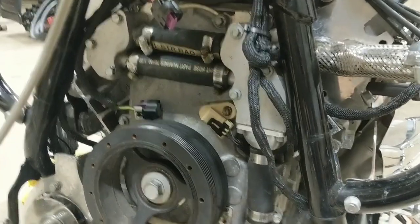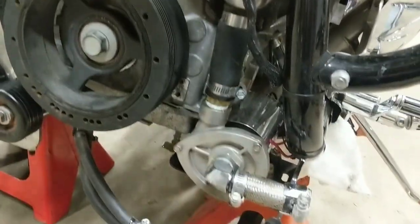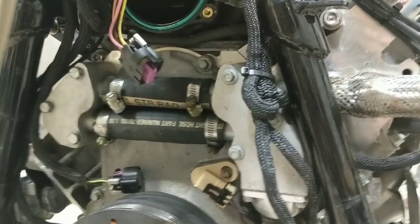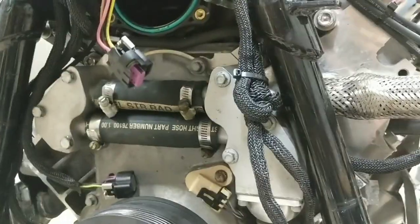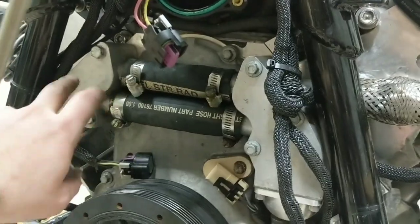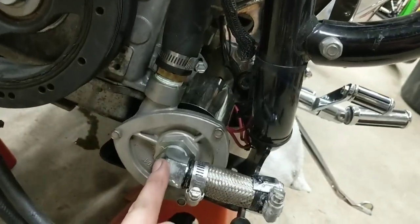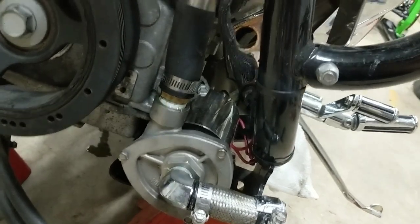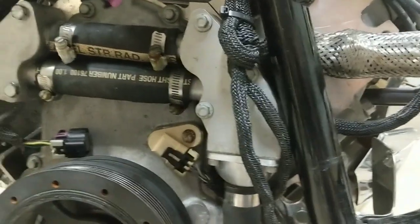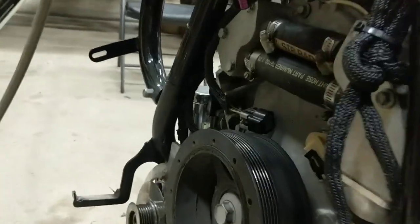So now the belt's out of the way. We're going to remove what I find to be the most interesting part of this whole thing — the water neck assembly. I think this is what allows them to put this engine in a motorcycle. Two hoses here just bypass back and forth to allow water to feed through the block. There's a regular thermostat housing and it goes right into the electric water pump that feeds the radiator and circulates everything. This is pretty compact — it sticks out way less than the harmonic balancer — and I think that's kind of the magic behind the whole thing.